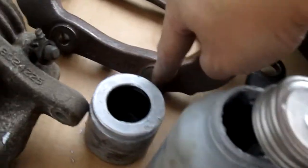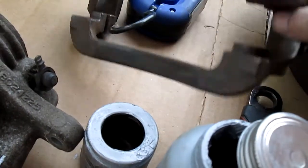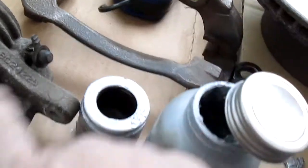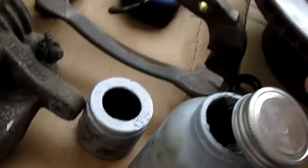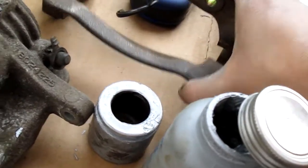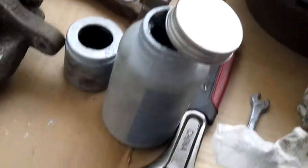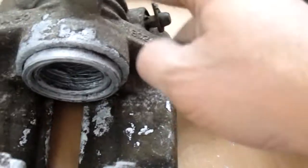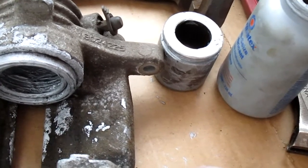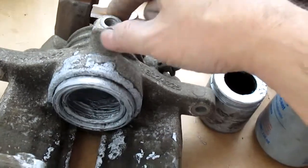Even these little holes right here — I cleaned this all up, it was a little rusty before. I used gas, then washed it all with water, then went on the grinder and wire brushed it — that's how we got this result. For these parts right here, just put anti-seize on them — any part that adheres together — because later on if you have to take it apart again, like for the brake fluid to enter and everything, it'll be much easier.